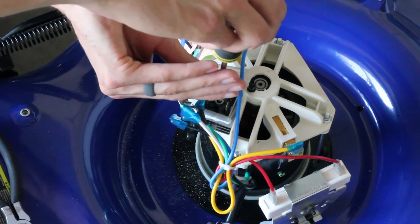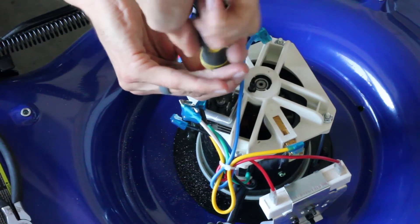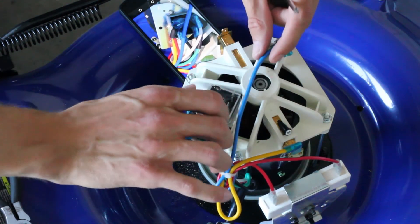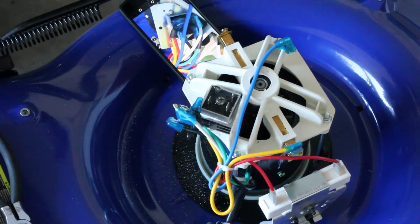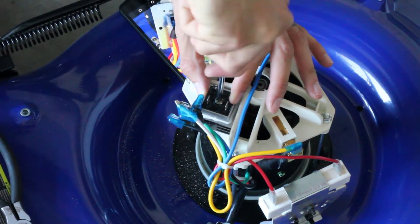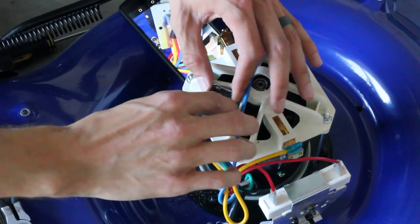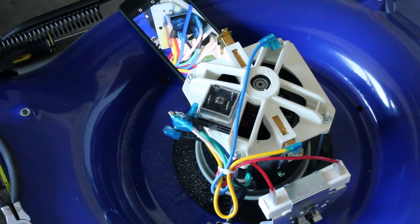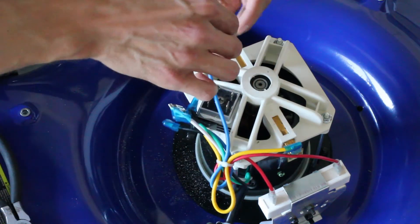This is just going into plastic, so I have a wood screw. Looks like it found the hole. Make sure that it's looking pretty decent here. That's the cap. We're looking really good here — get some downward force on it. That thermal compound is really sandwiched in there. It's not touching the commutator. All I have to do is let the wires plug back in — this one goes to the brush.